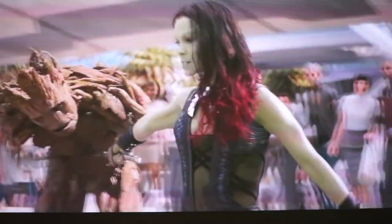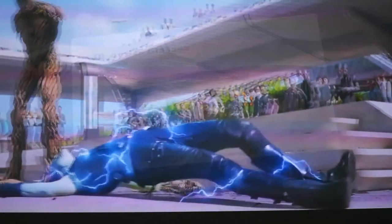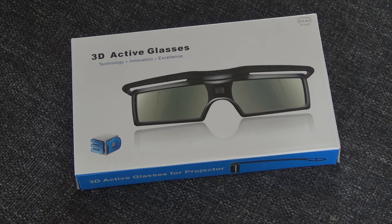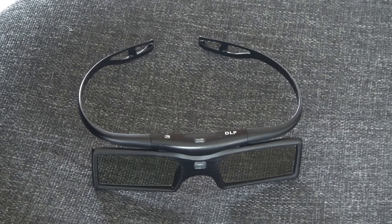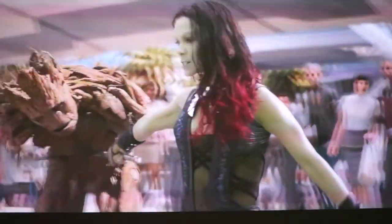Pleased to report the 3D is also pretty amazing, although it is a little jerky in comparison with the HD33 as it doesn't have the frame interpolation. It really does a remarkable job - the colour, clarity and brightness are really, really good. I've actually got these 3D active glasses from eBay, Sintron I think they were called, two pairs for £15. DLP Link is the only type of glasses you can use for this projector, and these work pretty good - they never had a sync problem. Sometimes I've had to invert the image but that's about it.